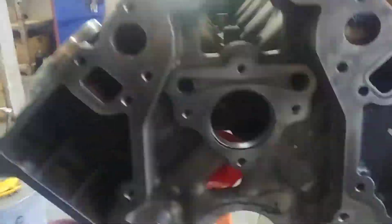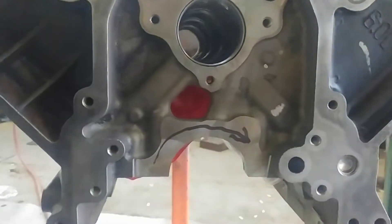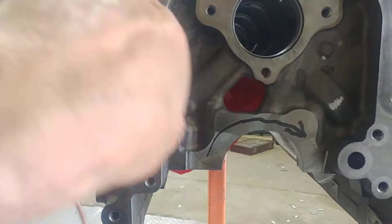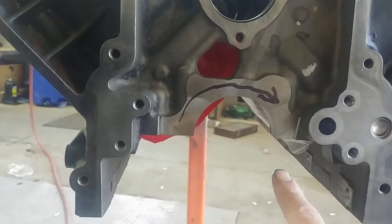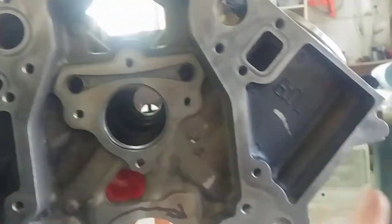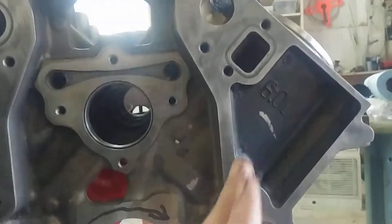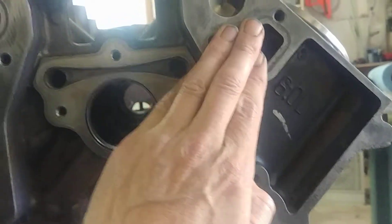See my little arrow? As the crank rotates around, that piston is pushing down across the outside of the crank as it swings down and around. That pushes thrust to the outside of that piston. But on the other bank of the engine, because the crankshaft is still going around in the same rotation, that one is pushing down this way, which is putting thrust on the top side.